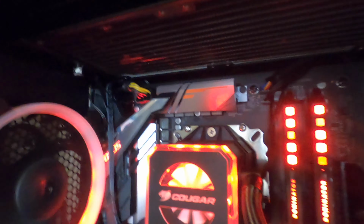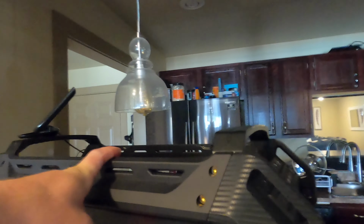Same deal, there's big cutouts here on the side. There you can kind of see I can fit my finger all the way through. But these fans are right up against the glass almost. The reason being, I tried to mount them inside, but it's very tight up in this top right corner. So if I had the fans on the inside, they were hitting. And it also didn't clear that VRM cooler on the motherboard. So I had to mount the fans up top.